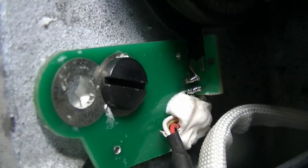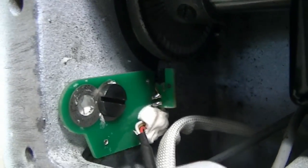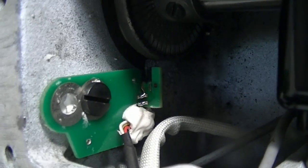So to time that needle up, needle down, pretty much, you put it at the very edge of the magnet and then it will stop when your needle's up. It'll stop when your needle's down because it will lose it. That's all there is to that.